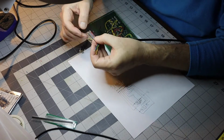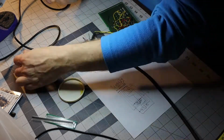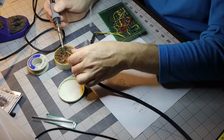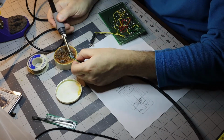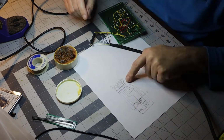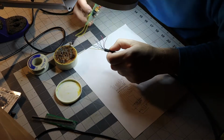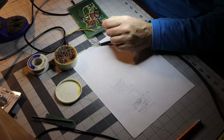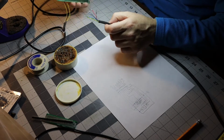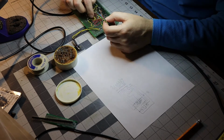To program the screen, I would disconnect the screen from the electronics and use the same interface wires to program the screen. That will not work that well once everything is mounted to the bike, so I came up with another solution, which we'll get to later. But first we need to make this screen board connection permanent and make a programming harness that will be used once everything is mounted to the Goldwing.